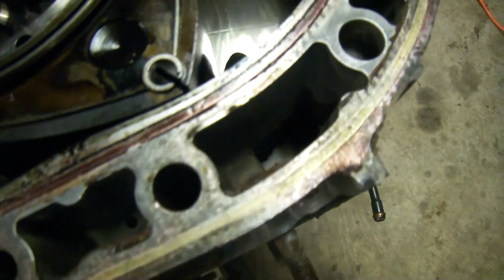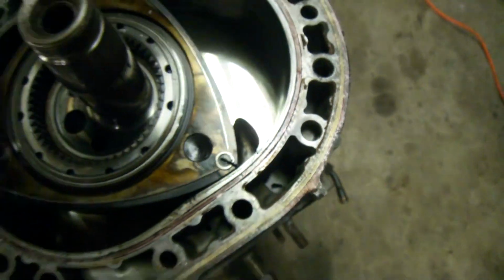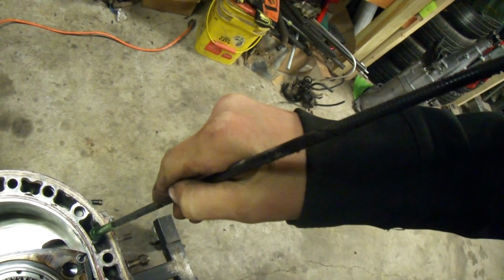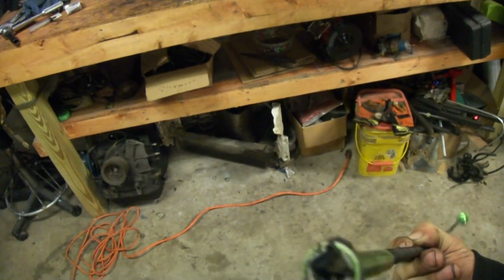Alright y'all, prime example right here. Just took that out. See that down there? Missing a corner. Super easy to drop them in there. So I'm going to fish that out before I lose it, because I want to make sure it goes back in the exact same spot in order to ensure maximum compression. Oh man, the old magnet spends too much time near the grinder, if you know what I mean. Please be small enough. Hell yeah. Right there. See that corner?